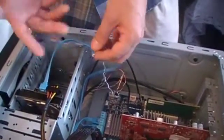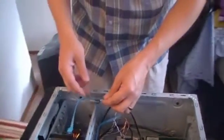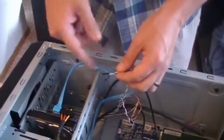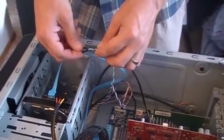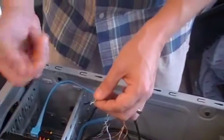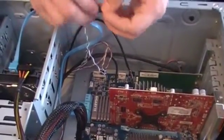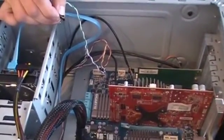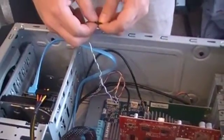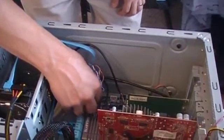This is the power LED — it's the light in the front when your power's on. I had mentioned in a previous video that there's some disagreement among motherboard and case manufacturers whether these should be two or three pins. Sometimes you end up with a three-pin one on a two-pin case. Sometimes you need to use a carpet knife to cut them, but these are already split, which accomplishes the same thing. The middle pin doesn't do anything — it's just a dummy slot. This is actually a three-pin setup, so it's good that these are already split. We'll get the positive in first and then the negative goes all the way over on the side.